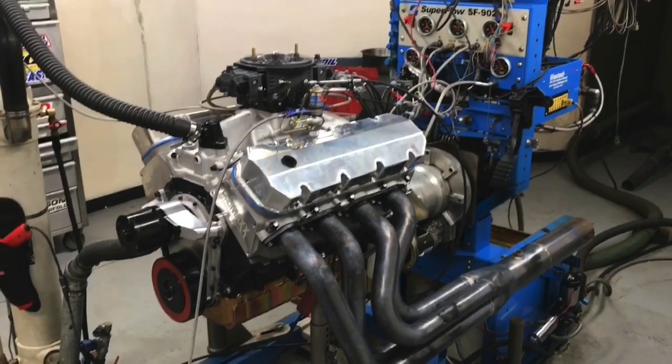Let's get to our conclusion. Personally, I love this little 496 — it makes good average power and peak power, and that's what big blocks excel at. We don't spend all our time at just one RPM; when we're accelerating a vehicle — whether it's a Camaro, Chevelle, or C10 truck — we accelerate through an RPM range, and that's what big blocks excel at. This 496 had good peak power, good average power, and even better power once we added the nitrous. That's the benefit of our multi-purpose build — it wasn't dedicated for one thing, it allowed us to put power adders on. When we added the nitrous we picked up a ton of power — that should be eight second power.